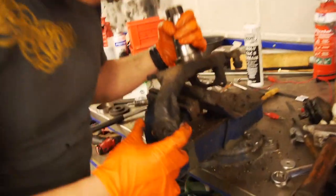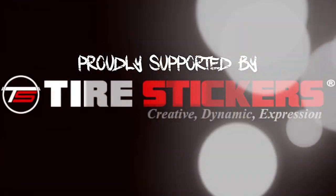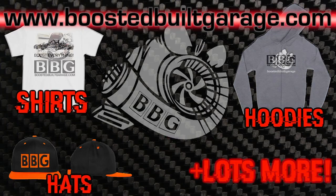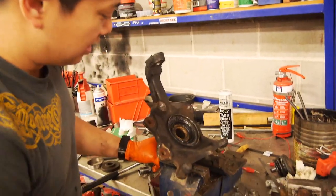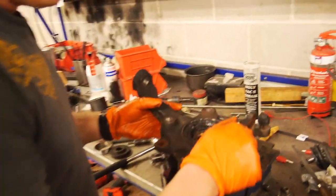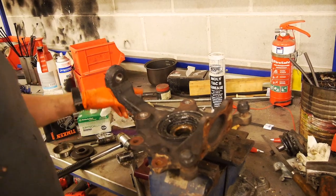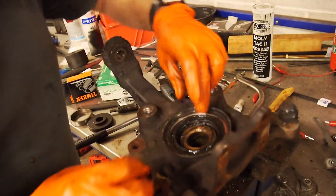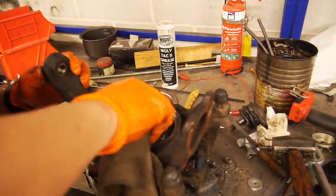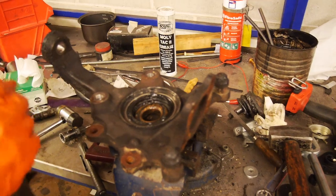Micro cracks through the whole thing. I figure that's why they have these pads here — they've got two flat pads on either side. On to the spindle. So we've got that out. What we'll do is get most of the dirty grease out of here, because we're going to keep this oil seal. If you're following, I think you have to order these OE because Auto1 had no idea — we couldn't find them anywhere.